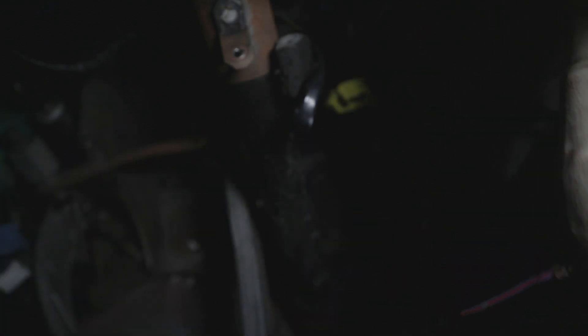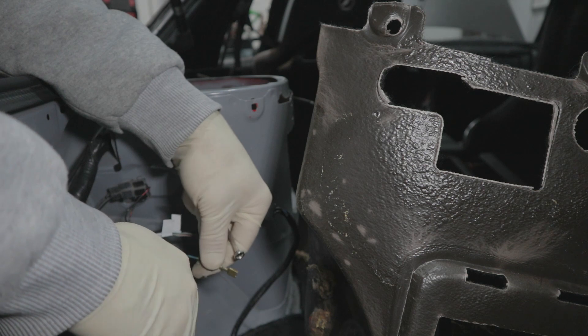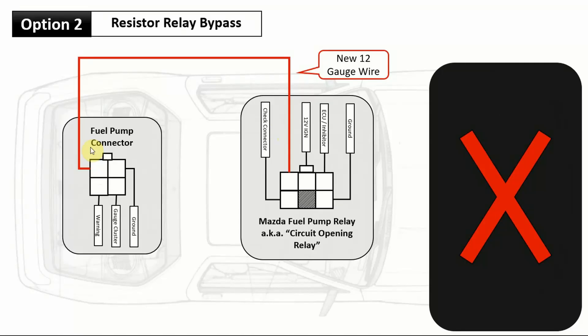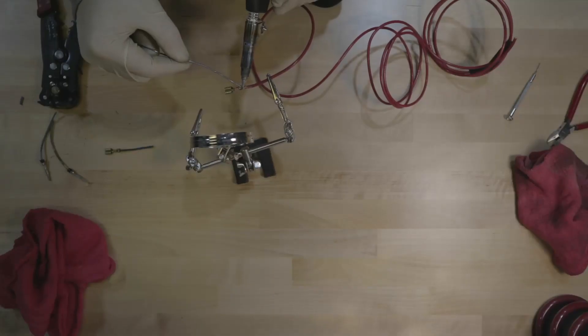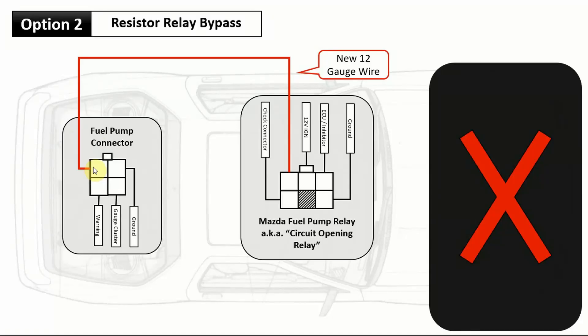The part of the old wire that stayed in the car on the harness — tape that off with electrical tape and set it aside. No exposed wires. Do the same at the fuel pump connector: de-pin the stock power wire, cut it leaving a little wire on the spade, and solder the new 12-gauge wire onto there. You can crimp instead of solder if you don't have a soldering iron. Get yourself about 10 feet of wire to reach from the relay to the fuel pump. You don't need to buy any fuses or anything else — the only difficult part is removing the interior.